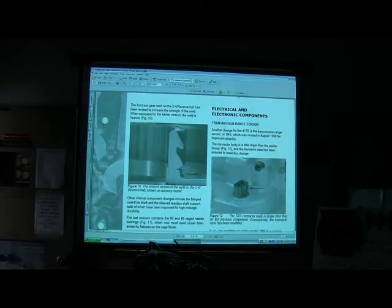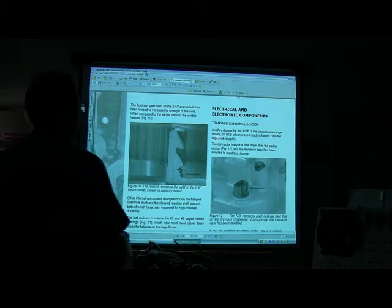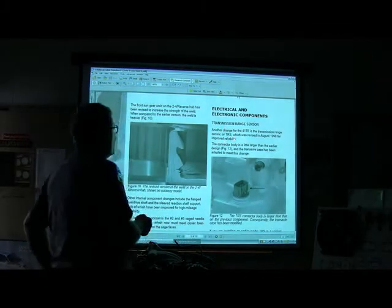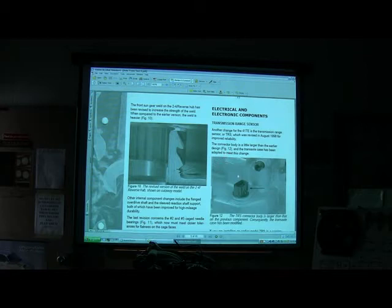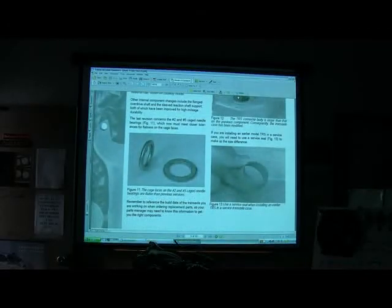All right. Now, here's your electrical. Now, you're going to come across an answer to one of your questions here in a minute. Another change is the transmission range sensor, which was revised August 1998. The connector is a little larger than the earlier design, and the transaxle case has been adapted to meet the change. See that? There's a transmission range sensor connector right there, and it's bigger than the one on the previous component. Obviously, if you try to put one of the other ones in there, it won't fit.